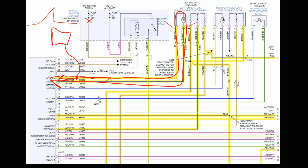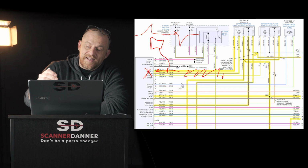You want to see, again, though, the reverse polarity for this. One way it'll go positive, the other way it goes negative. If you have an open in either of those circuits, it's not going to happen. If you have an open in the motor, it's not going to happen. What's not going to happen? Amperage. It's not going to be there. Or if you have driver issues, amperage is not going to be there. So if amperage is there, how's your driver? How's your wiring? How's your motor? It's all good. Does the test light do that?